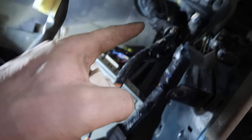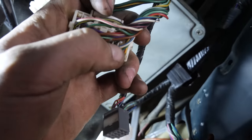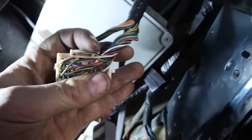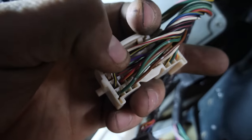And moving into the cab, this here is that II3 body plug we just talked about. See, this is attached to the 3-4 harness that we fished in the firewall earlier. And if we look, okay, right there, that is the white and blue wire that we need to give power to for all of these sensors and stuff. And right there, a little bit trickier to see, is the black and red wire that we need to give power to for the injectors and coils.